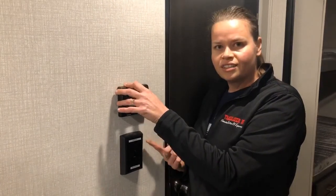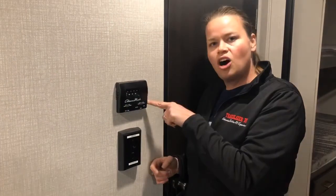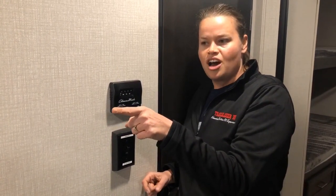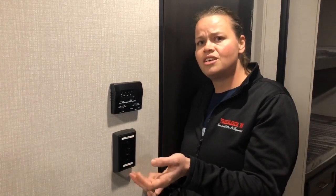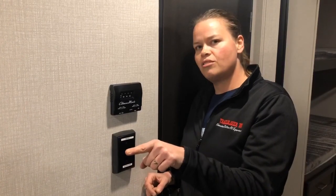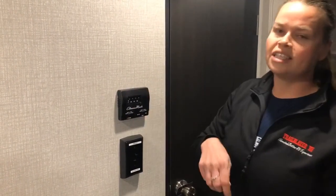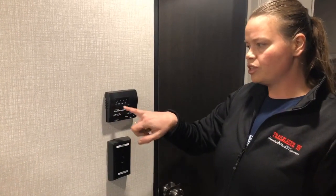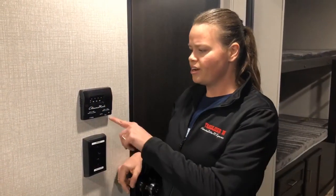When you're done using the furnace, when you shut it back to off, you're going to notice that the fan will run for, again, another 30 seconds to a minute to finish that purge cycle. Even though the flame has gone out already, it is going to run through that cycle. On the air conditioner, we're not plugged in now, so it's not going to work, but it's the same function. Turn to cool, again, select your temperature. That air conditioner will kick in on its own from there.